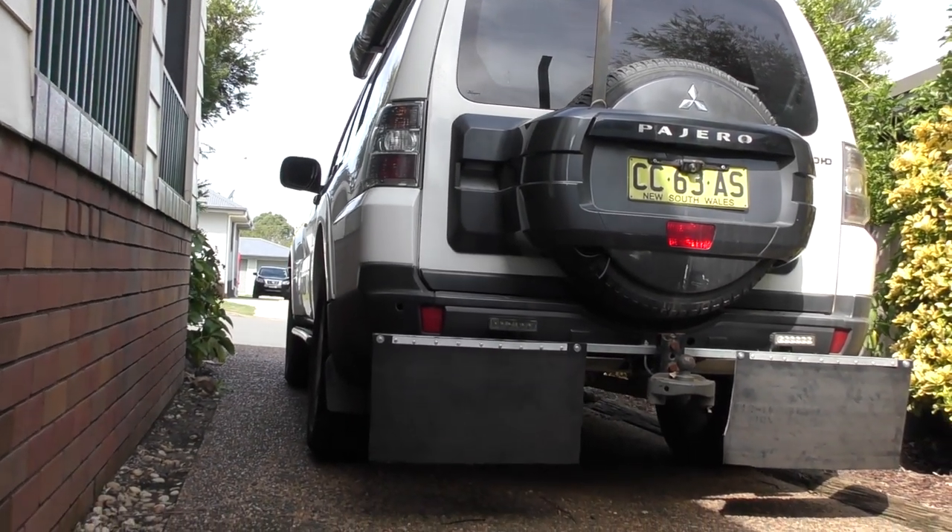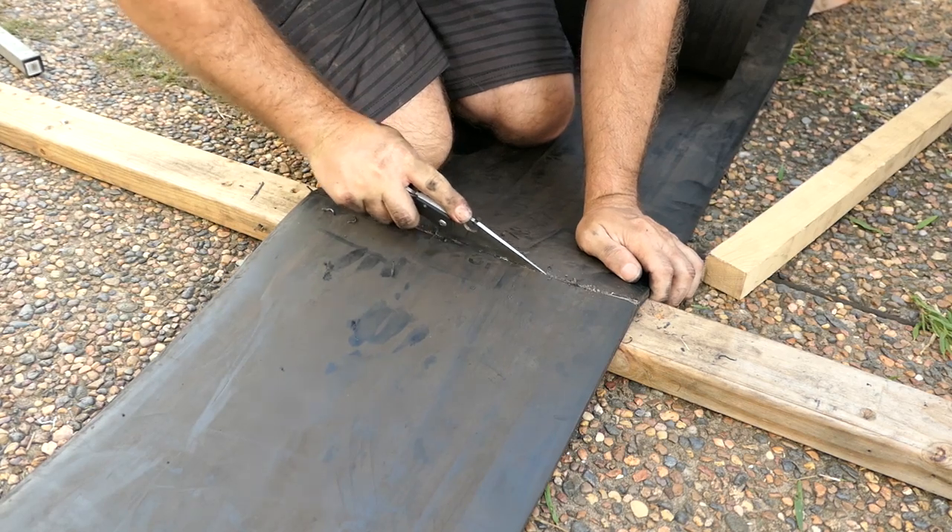Okay, that is us for the weekend. I'm working on the rock tamer for the back of the car — I need to cut some more rubber on that, so that'll be a video coming up. But that's pretty much the caravan done. What I do need to do is go around and get some slightly longer bolts so I can get those spring washers on — I'm not going to be really happy until I get that done. When I've tightened it right up, the aluminium of the square tube has squeezed in a little bit, so there's going to be a bit of back pressure which in theory should hold those nuts in place and stop them backing off.